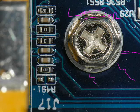Now, that's a little unlikely because it's a fiberglass material layered with various types of coatings and things like that. But nevertheless, you can see how close this is to certain electrical pathways, for lack of a better word, circuits and the like, and you wouldn't want to take the risk of damaging any of that. So again, just finger tight, which means you don't tighten your whole fist around it and lean all your weight into it and turn it as hard as you possibly can. Just fingertip tight is usually fine, and you want to just snug it down.